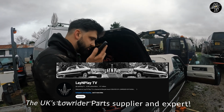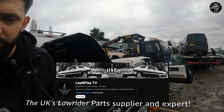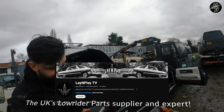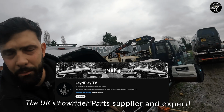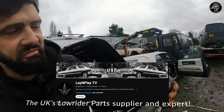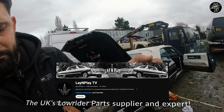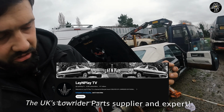Right, next thing is, when I get hold of the ram, if I can hold that a sec, Dave. You hold the phone and hold the mic on it, so he can hear you. Right, the ram itself looks very... Oh, just shot myself in the arm. So it moves very freely up and down, quite easy. If I put my thumb over the top of it, I can move the ram nearly three-quarters of the way up and then let go, and it's pressurising.